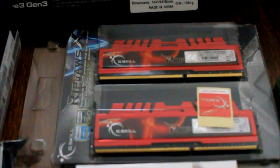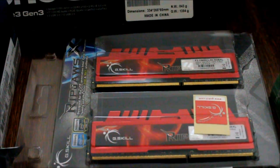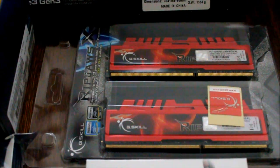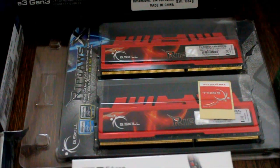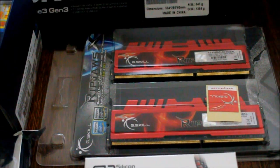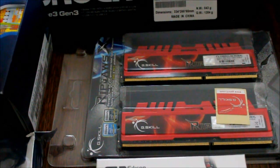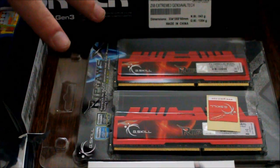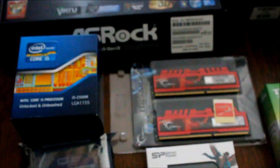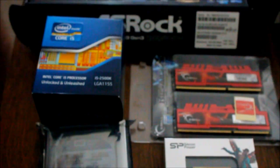We've just got 8 GB of RAM at 1600 MHz. Most people ask why not go 2100 MHz or 16 GB — well, the motherboard we got supports up to 32 GB. You're never going to have RAM issues. This Ripjaws is really good quality and it's going to utilize all of it without issues syncing. A lot of motherboards, if you get high-end RAM running at 2100, it doesn't actually sync at 2100 — so you're paying for something you're not getting full use of. 1600 is really safe and gives you a bit of overclocking headroom too. You've got 4 slots, so you can go up to 16 GB or 32 GB.